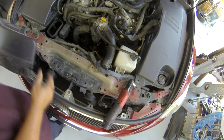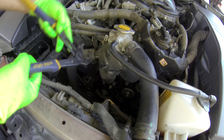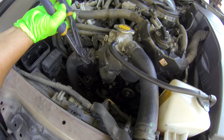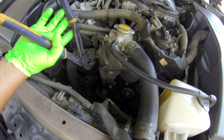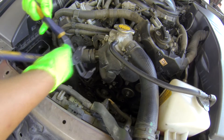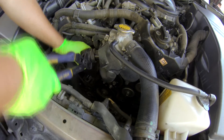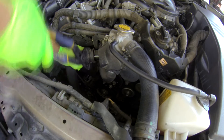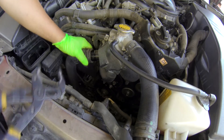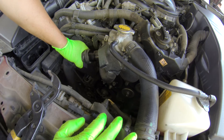There's plenty of room right there. I didn't drain the tank but I put a tray underneath to catch any coolant drip. When you do this, make sure there's no pressure and the car has cooled down — sometimes there's pressure and it can be hot, so be careful when you do this on your car.